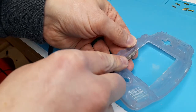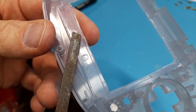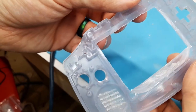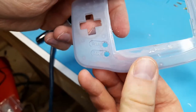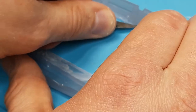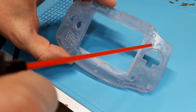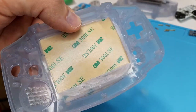Because I use a power tool, I build up these little burrs, so I just scrape them down using a file. Do you see this little ridge inside the casing? We need to completely get rid of that. You can use a file, sandpaper, or if you're impatient like me, just use a Dremel. The screen protector is going to go over that area so you won't see it. The disadvantage with the Dremel is that I can't get the ridge in this little corner, but because it's so small I can use a knife and gently file away at it. If you're doing this, please cut away from you. Another disadvantage with the Dremel is dust everywhere, so I just blow it away with compressed air. I double-checked my work to make sure the window line is inside my cuts, and don't forget to remove that wall at the start and select button — really, you should cut all the way up to the directional pad.